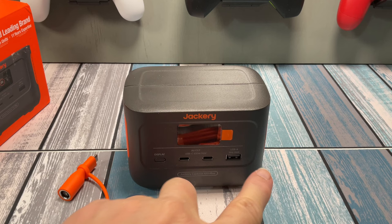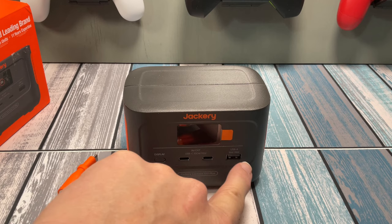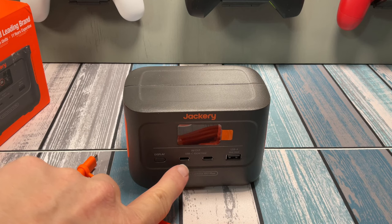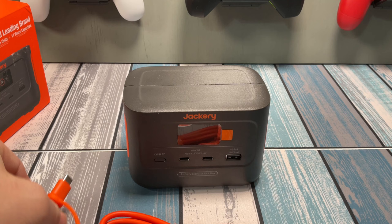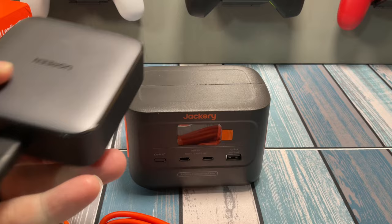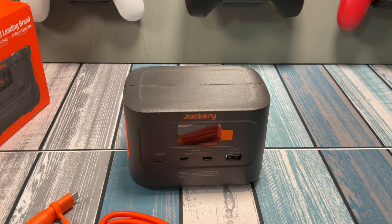If you use them both together, you have 110 watts max output. And then sitting right next to that is a USB-A, which is 18 watts max — your typical 5-volt adapter, but it will also do 9 volts at 2 amps and 12 volts at 1.5 amps, so 18 watts total. If you use the USB-C and USB-A together, you can get 100 watts out and 18 watts out — that's 118. If you're using both USB-Cs together, that's 110 plus 18, which is 128 watts — what they call this thing, the 128 watt solar generator. Now input-wise, you can do 100 watts input into any of the USB-C ports, but you would need something that generated 100 watts to begin with. I used a Ugreen wall charger, and one of its ports is 100 watts max, so that's what I used to test this with. At 100 watts, you can charge this thing all the way up from zero in about one hour.